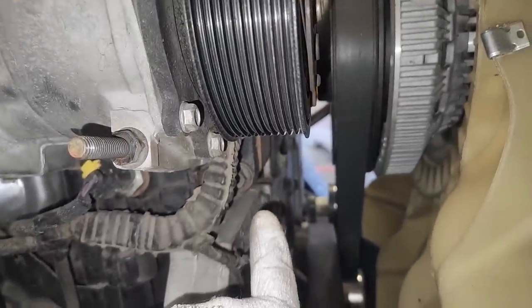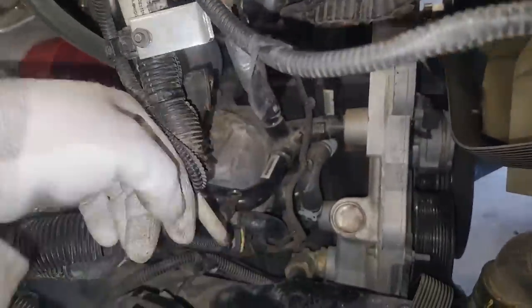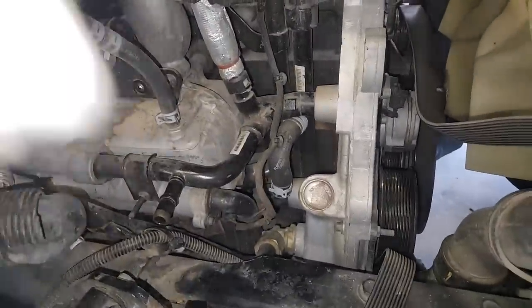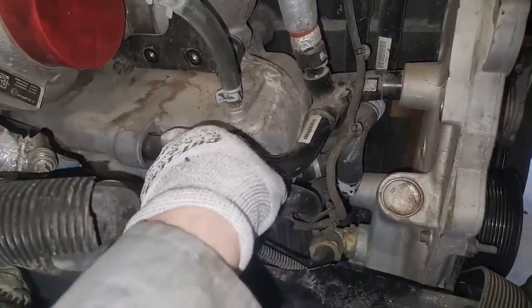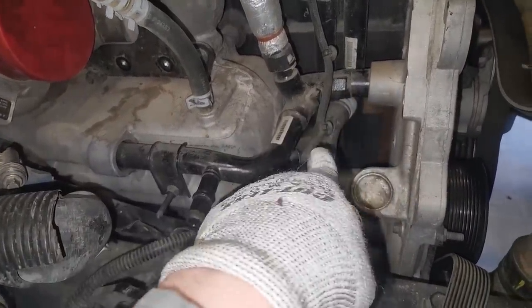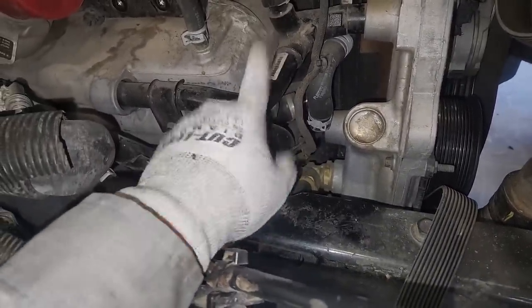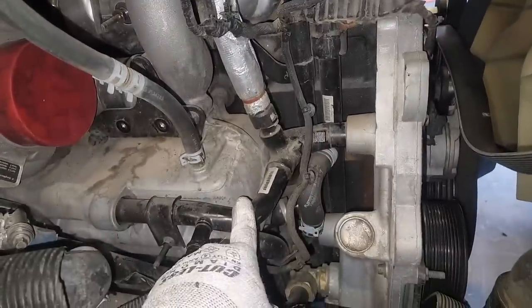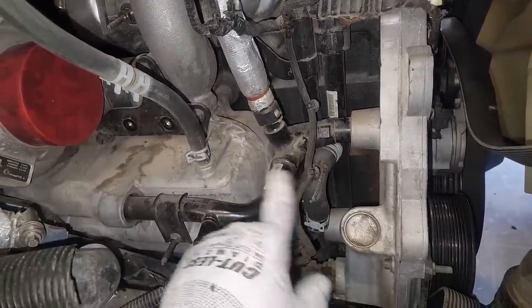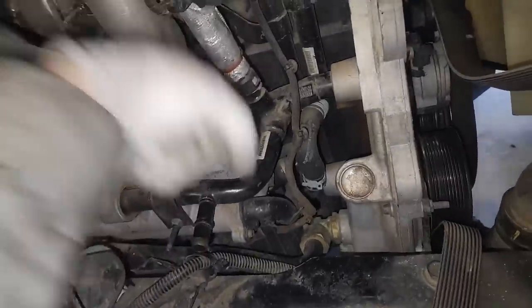Bolts are off, we can now see if we can get this tube off. And at this point I realized - no. It's a solid steel tube with an O-ring going from the EGR cooler to the front structure, so you can't move it either backwards or forwards without pulling either the EGR cooler or the front structure. Really awesome design, guys. I hope that tube never leaks or else you'll be pulling one of these stupid things off. Really, really brilliant design.